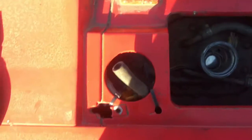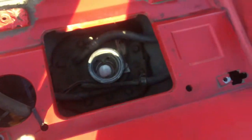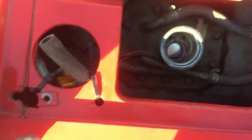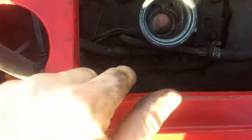So it's removed — here it is. There was this hose going into this fitting here, so it wasn't actually bolted in. It was just plastic form-to-fit, so you just had to wiggle it out. Now here's the inside. It looks like we got a bit of leakage on the side of the tank coming out of this. So good thing I got a new gasket. It looks like this is just RTV — someone didn't even put a gasket on. This has obviously been touched before.